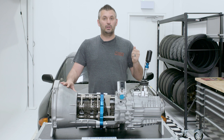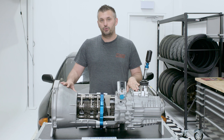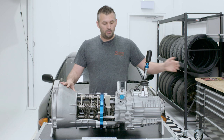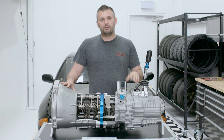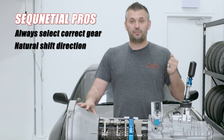A sequentially shifted transmission, generally speaking, can't go straight into neutral, so you can only go through the gears one at a time. That doesn't really have any cons on the racetrack, but on the drag strip or the dyno, you'll find that some people, when they finish a run, pop the car in neutral to take all the load off the engine. With a sequential transmission, if you're in fifth gear across the line or at the end of a dyno run, put your foot on the clutch and go through all the gears back to neutral — the back wheels are still attached to the gears, and you can imagine the huge RPM in first gear when you're doing 200Ks an hour trying to get back to neutral, and it can cause some serious damage. So that's really one of the only cons of a sequential transmission.